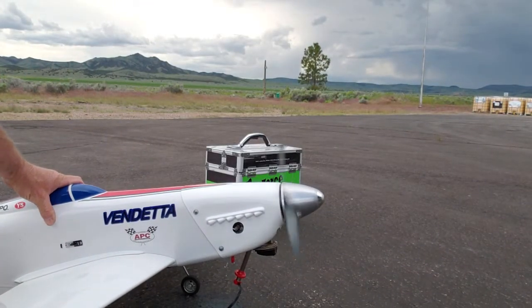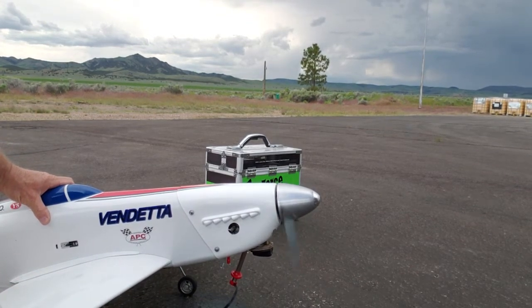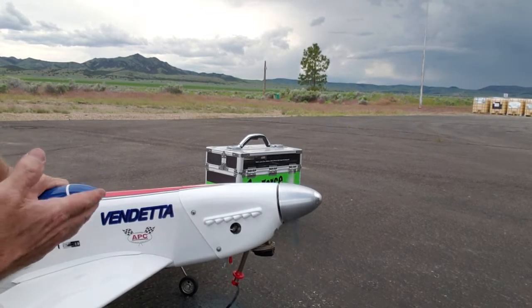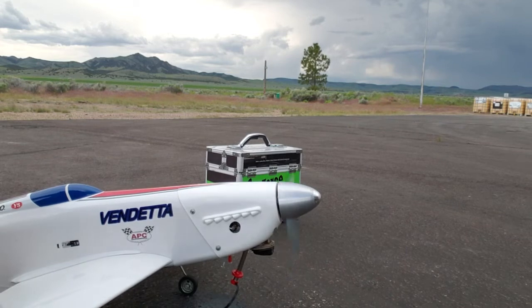What I'm going to do next is I'm going to slowly increase the RPM. I'm going to turn it down a little bit at a time until I feel and I can hear the engine pressurize again. And then I'm going to tune my needle, and I'm going to do it slowly.